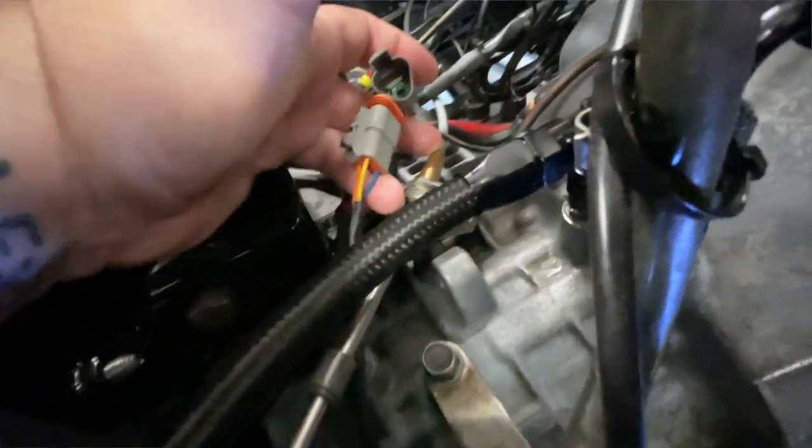Alright, I'm not going to lie, it's Sunday now. After the findings Saturday afternoon, I just gave up — sometimes you got to walk away from it for a minute, it's okay to do that, come back and fight it later. So here I am. What I'm going to do is — I did a lot of thinking about it after I left the garage yesterday. I have my solenoids plugged in to my harness, and the wires that are on the harness go to the ECU, because at one point I was going to have the ECU control the transmission. I'm thinking it's possible that power or ground could be sent to those outputs even though I don't have them configured in the ECU. I don't know what's happening with them. So what I've done is disconnected that, because it's supposed to be in third gear with no power or anything to the solenoids. I'm going to put the gauge back in the RC port, start the car up, and check the pressure there.